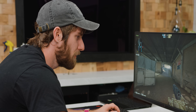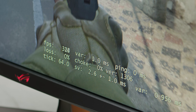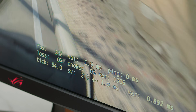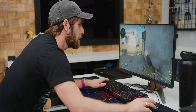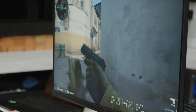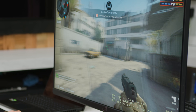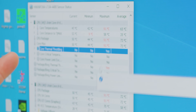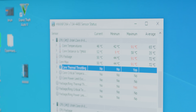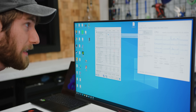Let's go with the CPU's default behavior and see what happens. And once again, no obvious problem — we're anywhere from 250 to 350 frames per second. Obviously that's easily playable and smooth. This is with a Core i9. But while we were gaming, we had a maximum of 91 degrees, and yes, we did in fact thermal throttle — and this is before we even ran an intensive all-core load like Cinebench.